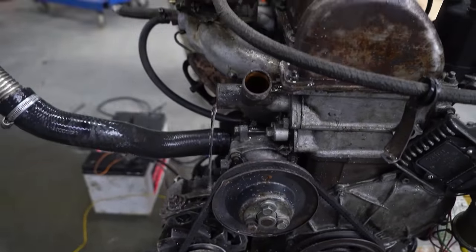So when we started, and the engine still had steel rings, the compression was 6, 7.5, 7, and 7. Then after we installed the rubber rings, it grew to 8 in cylinder 1, dropped to 6 in 2, 4 in 3, 5 in 4. And then we started it, we allowed it to run. This is indeed a very unusual phenomenon, with the compression leveling out to 8. Now, I don't know what grooves they could have filled, but the engine most definitely runs.